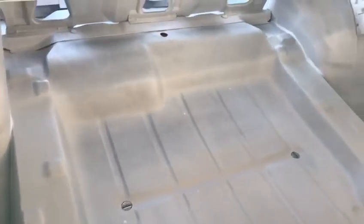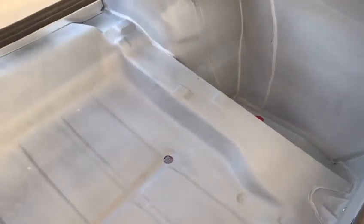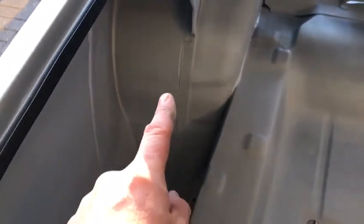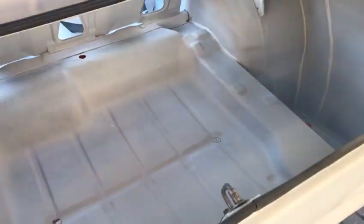The boot floor is one of the very few parts of the car that are original, believe it or not. There have been a couple of localized repairs — small sections of corrosion that weren't enough to warrant a full replacement, so I did localized fabrication and welding to those sections. This side's outer inner arch was replaced with a new item. The outer arch, from that seam out to the bubble, was fabricated to meet up to the bubbles — so the boot is in perfect condition.